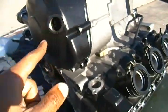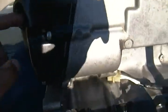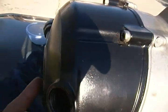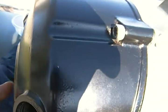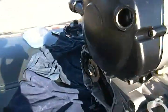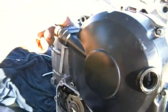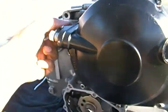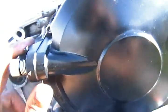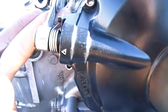And don't worry about a magnetic tool. As long as you turn the teeth thing inside the clutch plate and push it in towards the clutch plate, it'll guide in that direction anyway. So you don't need a magnetic tool, because you can fully see my clutch is engaged. When I turn it around, my arrow and everything is engaged, right? I turn it, it's all engaged, it lines up, and you can't turn it back the next way. That's how you know it's engaged.